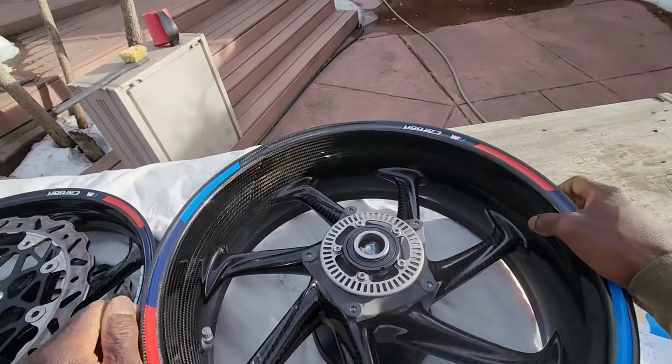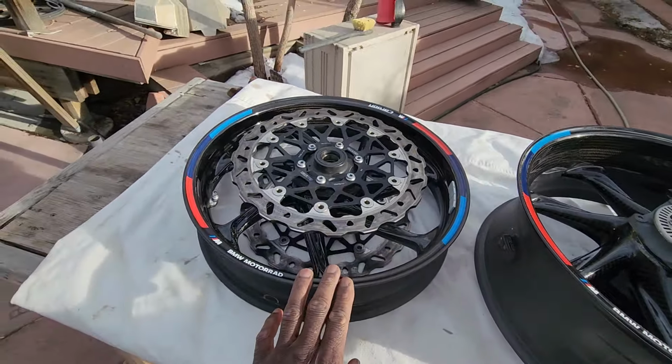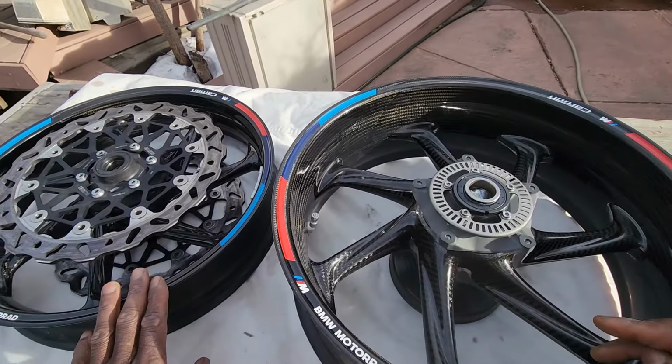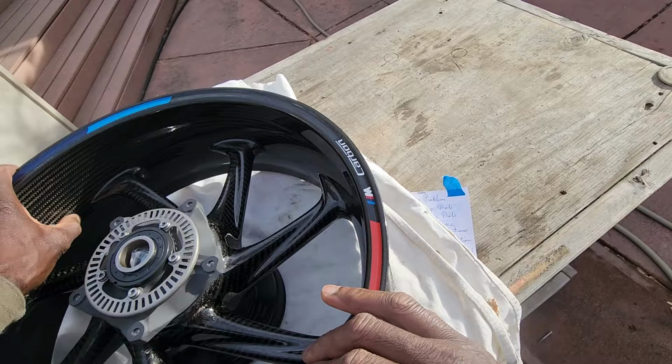Yay. It turned out that the front wheel was fine, because once we put a new tire on it, it didn't leak anymore at all. And once we put the old tire back on, for whatever reason, it didn't leak anymore either. So the front tire turned out to be fine. The rear tire turned out to have this leak through the seam.